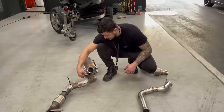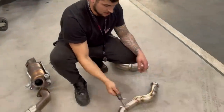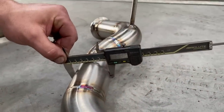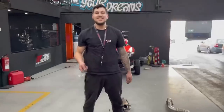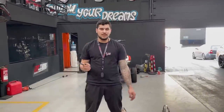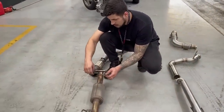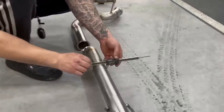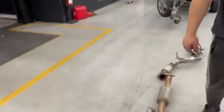Originally, it has an exhaust of about 59-something millimeters. And now — can you come and show this? Show it clearly so there are no doubts. We then have another part of the exhaust. We continue with a line — I'm pressing as hard as I can. What does it say there? 60.20. So this tube is 60.3mm.